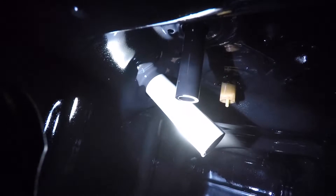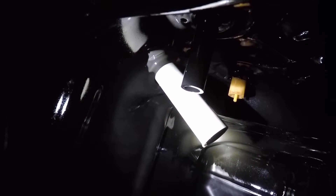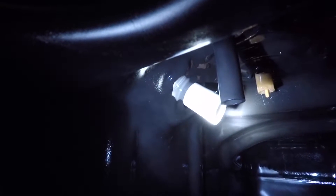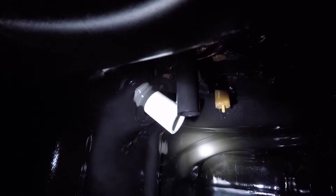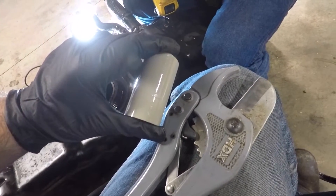Here I'm showing you the inside of the tank where you can see the filler neck and air breather. What I'll be doing is something called the harpoon mod, which is trimming that white pipe of the filler neck so it doesn't stick down as far into the tank. This allows you to fill the tank up faster and more because the pump won't shut off at the bottom of the neck anymore. Here you can see I've trimmed off a few inches — nothing crazy — but it should make a noticeable difference in filling.